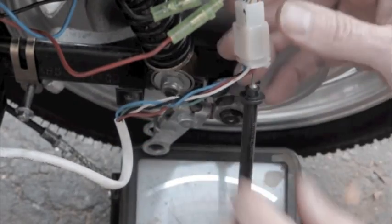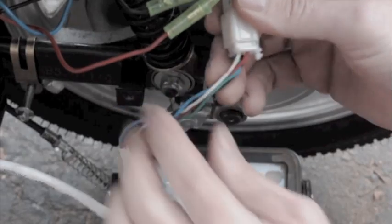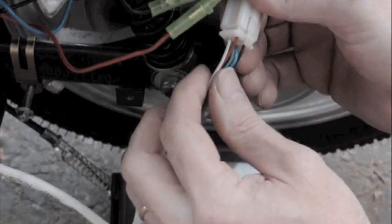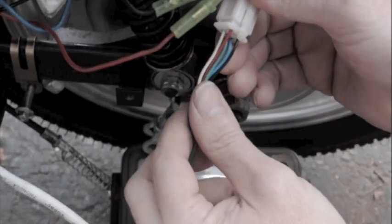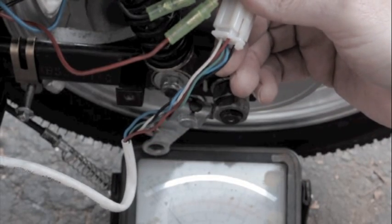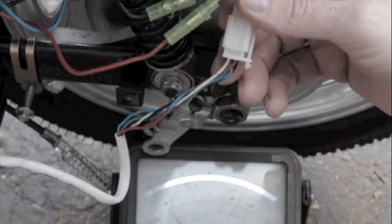So that way I'm able to use the power from the scooter to power the hall sensors. I don't have to set up a breadboard, I don't have to take apart the motor — I can just measure across those three, now that I know what goes on inside there, sort of.